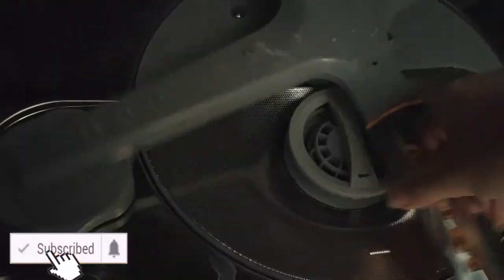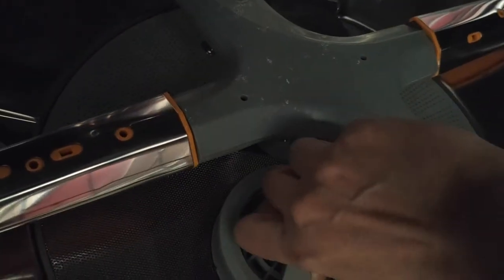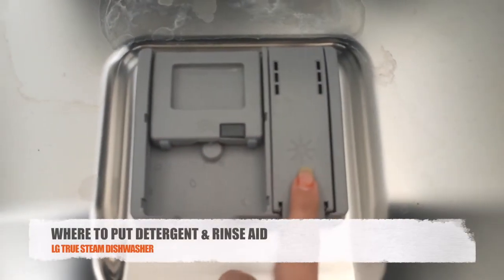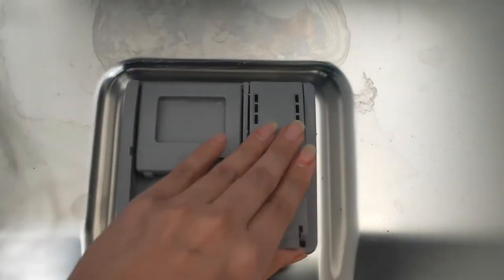This is the salt section where you need to put the salt. At the time of installation, the engineer will put the salt and water in to start the machine — without salt it will not start. This section takes around 1 to 1.5 kg of salt, so order at least 2 kg to start. There is also a section where leftover food collects during cleaning — you need to clear this at least once a week, otherwise the machine will smell. As this is a True Steam model, it has steam vents on the door — four vents through which steam comes out. The detergent and rinse aid go into separate sections on the door.